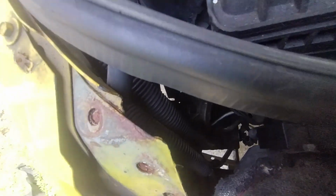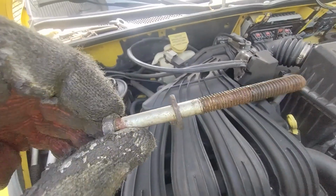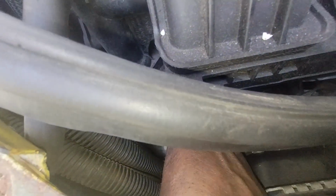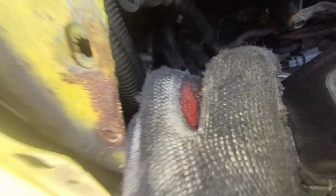Okay, I've gotten to the power steering pump, and here's the pump here, and it takes these 3 long bolts, take a 13mm socket, take those off, and then there's a bracket that takes a 15mm socket to get those bolts off. And what I do is I move the bracket up here instead of taking it all the way off. Well, maybe I should just take it off, but I was going to attempt to get the power steering pump to squeeze out of there. I'll probably wind up taking this bracket all the way off just to get some more room. And this is the radiator, and it moves about a little bit. It's supposed to give you enough room to get the pump out of there, out of this little hole you created.